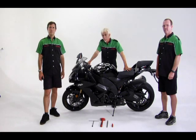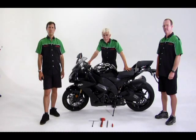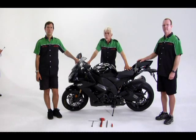When you hit a bump, the energy created by this bump is stored for a moment in the spring as it compresses and then releases as it rebounds. A very stiff spring will store and release energy more rapidly than a softer spring. Too stiff a spring or spring adjustment setting makes the bike react harshly to the road surface and uses less suspension travel. Too soft a spring or spring adjustment allows the suspension to use more of its travel but responds too slowly to handle rapid road surface changes and gives a loose sort of feeling.